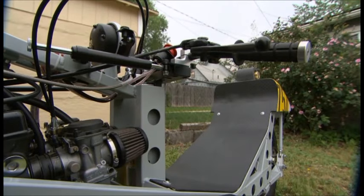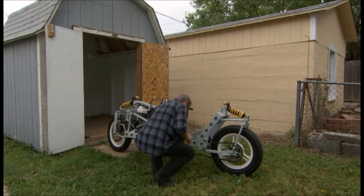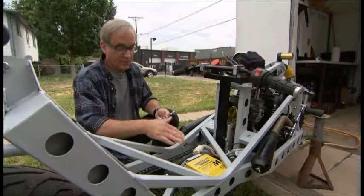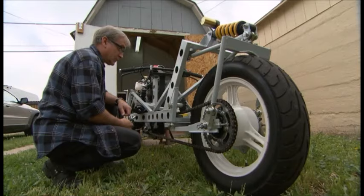What should have been Bob's first racing year was spent in his shed rebuilding the bike. The new and improved Rohorn is a beauty and it's ready to race again. "Because it's sealed, I was able to put the battery sideways. Normally it's standing up, but with it sideways I was able to mount it a lot lower than normal and keep the center of gravity lower."